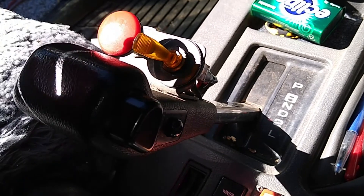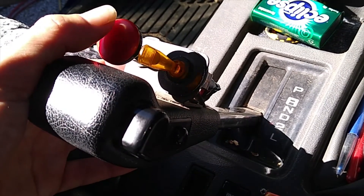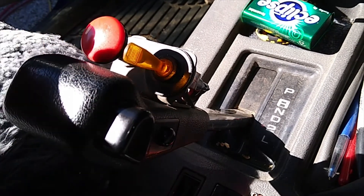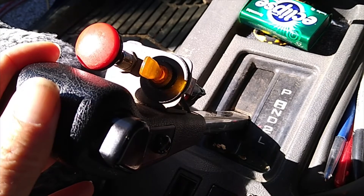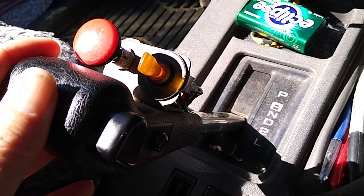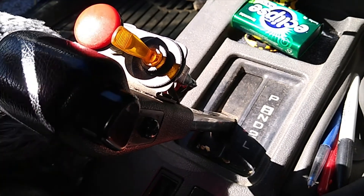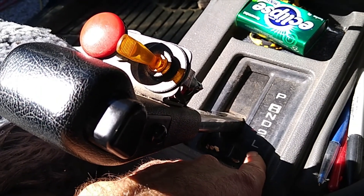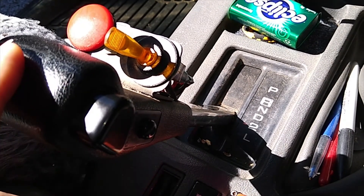If you've got an automatic, what you need to do is fit an automatic transmission lockup switch like this. To do that you need to intercept into the little computer and get the solenoid valve in the transmission to open or close — specifically the one that locks up the torque converter. Once you've locked up the torque converter you get a lot more efficiency on your exhaust brake. Now, be aware that torque converter lockup does not work on all gears — it doesn't work in low or first due to the valve body plumbing — but it does work in second, drive, and overdrive.